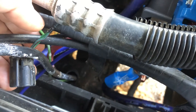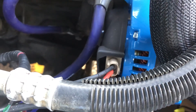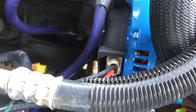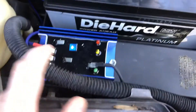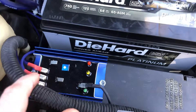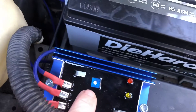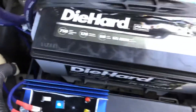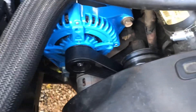In this case, mine uses an external voltage regulator here. My original connector is just over here, but mine doesn't actually plug in because I don't want to charge at around 14.2 volts. I'm going to add about 45 amp hours of lithium, so I need to charge at about 15.5 to 15.9 volts. Using this voltage regulator I can go to 15.9 to 16 volts no problem. I don't have any battery lights or anything on — everything works just like it did stock — and I just turn my voltage up with this little dial.